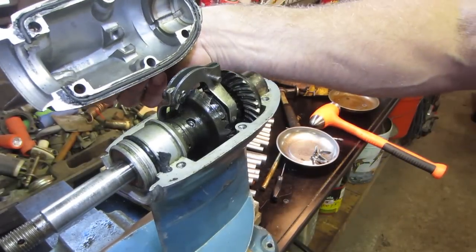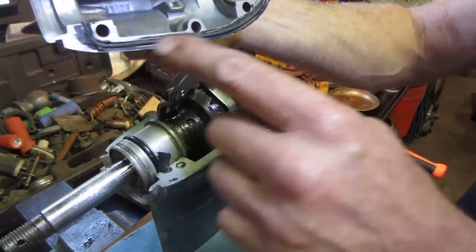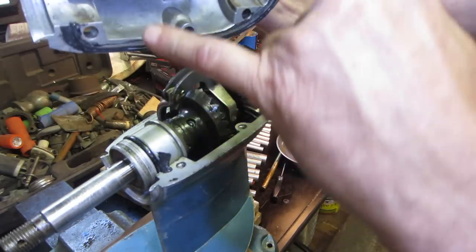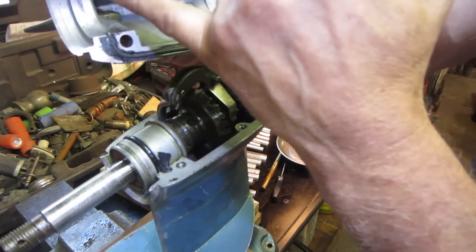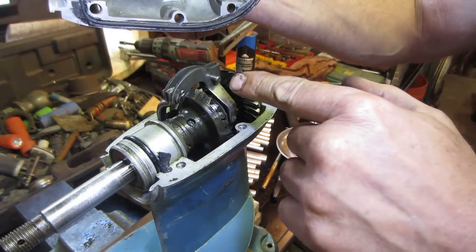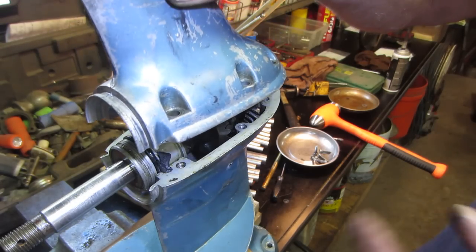The new seal that I put on there kind of just lays floppily in there. So I filled the groove with the right stuff first and then put the seal in it, gave a little goop there and a little goop there just to kind of bridge between where the O-ring is and where that junction meets. And I left those guys just a little proud. I don't know if you can see it, a little proud off of each end. Now, I'd probably say the trickiest part is going to be making sure that we get that guy into there.